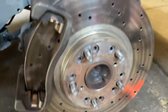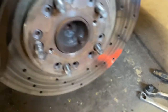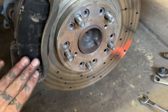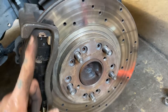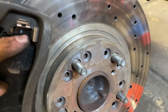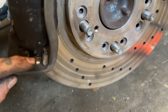And then what happens is when you are in reverse and you hit the brakes, the pads themselves are going to want to travel downward and there's these little springs in there to kind of keep them off of there. But when you hit the brakes going forward they're going to want to go this way. Those little springs on the bottom are going to keep the pads pressed up against this flat part. And if you put the springs on the top every time you hit the brakes you're just going to be flattening that spring out.